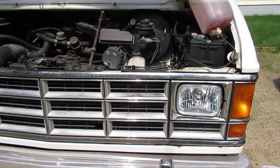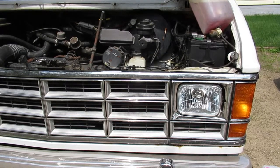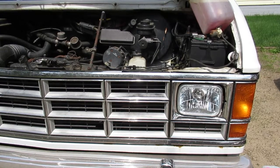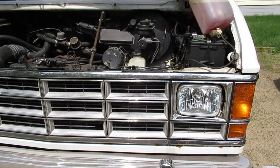Last year I changed the steering gear in this van. It's a 1991 B250 full-size van and I put in a Redhead steering gear. Something I ran into was that it was stiff to turn towards the right and it had lots of power boost turning to the left. I talked to Redhead Steering Gear about it and they said I need to make an adjustment on where the valve control body attaches to the power steering gear. So we're going to take a look at that.